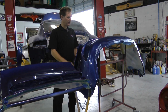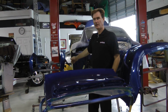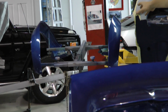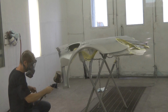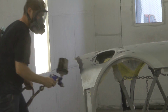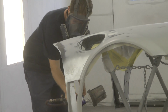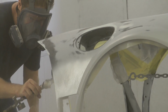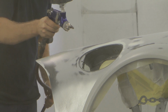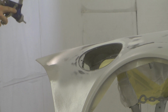We're going to be buffing it out to a mirror polish, and after this, it's ready to go on the car. You know, at the back here, you can see the flares have already been painted. That's our front fenders being primed, and he's probably going to put a couple coats on, let them dry out. Then we'll wet sand those, get them all smooth, look for any more pinholes, and shoot some more primer on it.